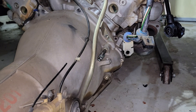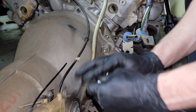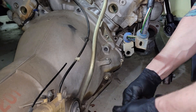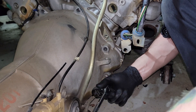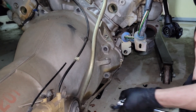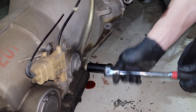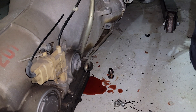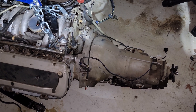And you've got to unbolt the engine — oh, the dipstick tube's in the way. As you can tell, I have the engine slightly lifted, just enough to make it easy to move. Starter's loose — that's fine, I'll just sit there. Got a little spillage. I did drain the transmission first, by the way. So here we are — moment of truth. Transmission is unbolted completely.